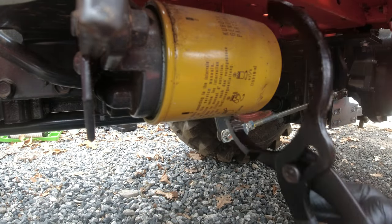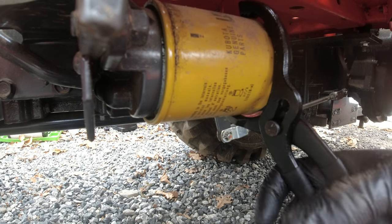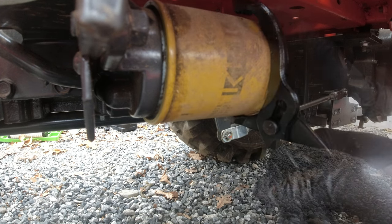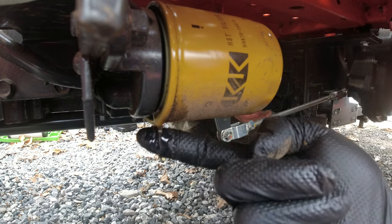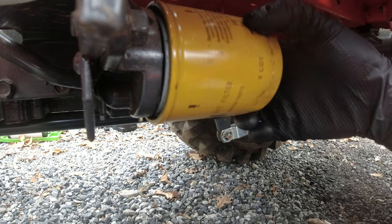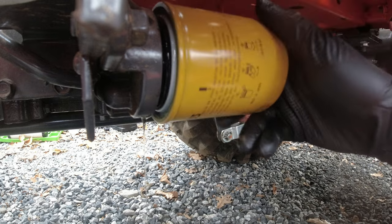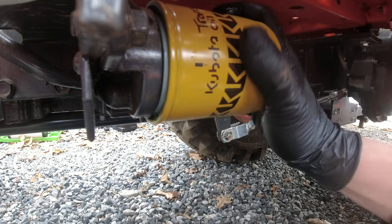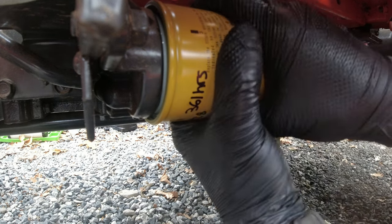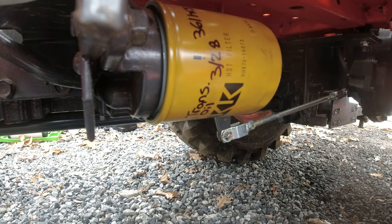Next up we got our trans oil. I do have my drip pan down below — you just can't see it. Just going to grab some of that, put it on my O-ring right here to make for a smooth switch. You don't lose too much doing this one. With these, do it until it makes contact and then do another one and a quarter turn. Okay, and that's that. My markings are right where I can read them.